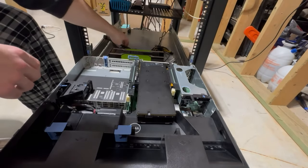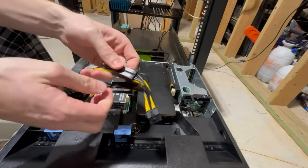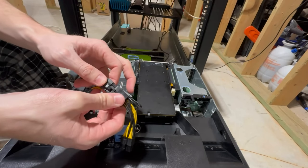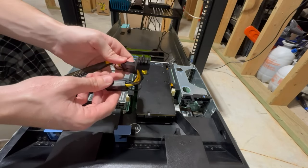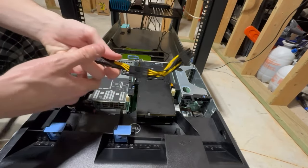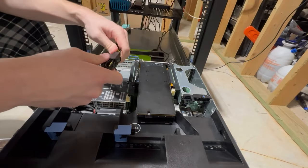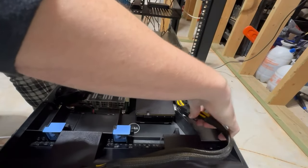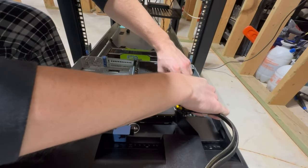Before getting things too tight, connect the cable. Put the two 6+2 pin male and the 8-pin female connectors together — snap them together. It should be fairly obvious how they go; they only go one way. Then you'll be ready to actually install the GPU. It's not the easiest — kind of a pain to get these put in place properly, so just know that in advance.